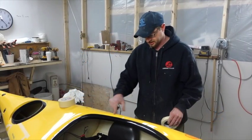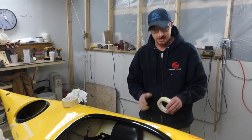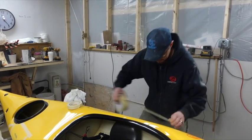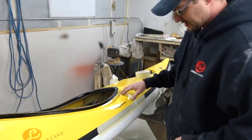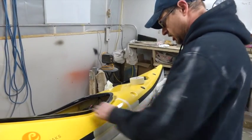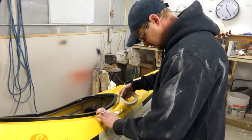I'm going to keep my repair down near this lip, so it's easier to hide on a turn rather than on a flat surface. I start with 2-inch tape to protect my seam — this is just a temporary barrier. I might have to go further or less, but it's good to have it there so I know a stopping point.